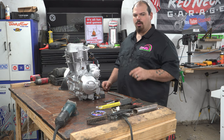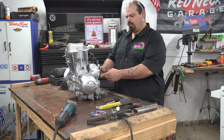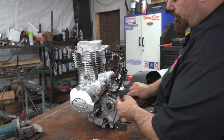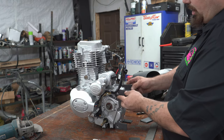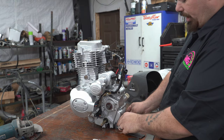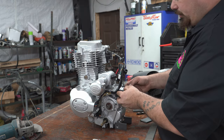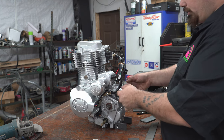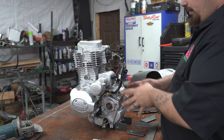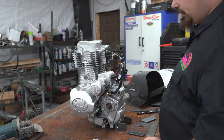We're going to get this set in there and figure out how we can get it welded in and bolted up. I already did a little bit of pre-drilling to put these brackets on. We're going to bolt them tight, and then put these two brackets down here — I already got these made up. We're going to do the front ones, and after the front ones are done, we're going to brace these all together. That way, when we mount it in the chassis, we can tack weld it, pull it out, and do that.